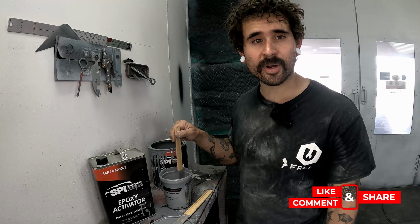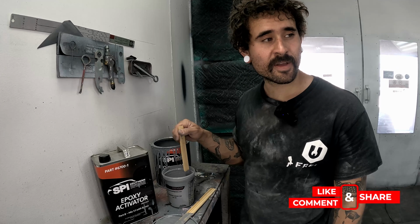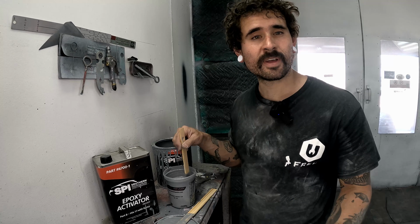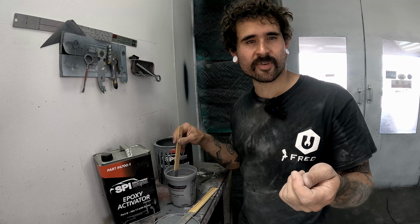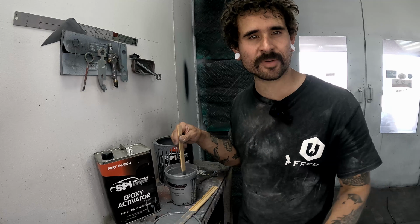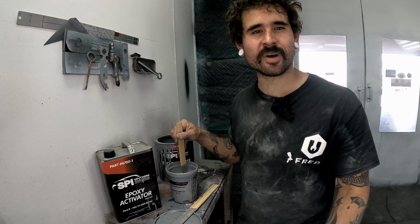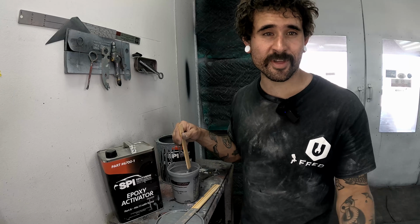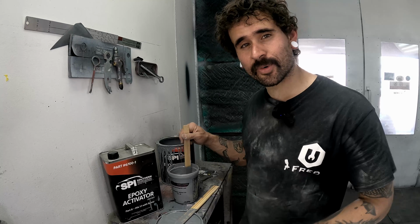The fiberglass stuff, I might do a third on. Normally with the bare fiberglass, 3 coats is recommended. 3 coats will help to stop any of the weave or any of the little hairs and fibers from showing through when the paint job's out in the sun. I don't know if you've ever botched up prepping a fiberglass part before, and then you put it out in the sun and you see the little weave kind of poking through a little bit.